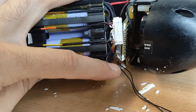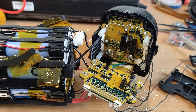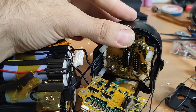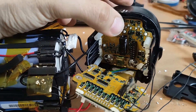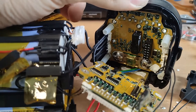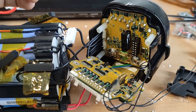Those cables here are actually temperature sensors. You can remove them for dismounting, but they don't have a connector, so make sure you don't rip them off. Here you can see the BMS — it also has smart functions. I can also see a 40-amp fuse. Here are the overall battery plus and minus connections.